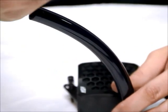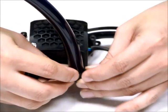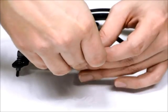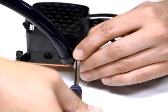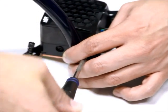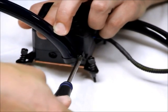Then take your clamp and orient it with the oval facing away from you, putting it down with the jaws oriented parallel to your pump. This way you don't have it turned in such a fashion that it will interfere with any of your components when reinstalling into your case. Take your screw, put it through, take your Phillips head screwdriver and tighten it straight so you don't mis-thread it. You're going to want this clamp completely flush with that flange, and tighten it down so that the jaws of the clamp completely mate — this gives the right tension on the clamp to prevent leaks.